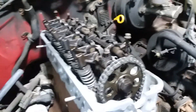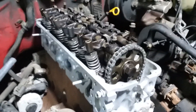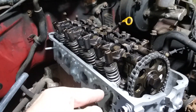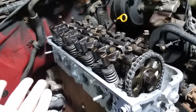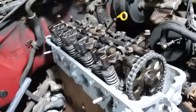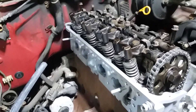This signifies the last of the actual internal mechanical parts that need to be addressed. Once I get this all torqued down, the valve cover can go back on and then it's just getting the intake manifold and the exhaust manifold back on. I did cut the cat off of this one — it was worth lucrative money, almost as much as I paid for the truck — so I sold it. Now I've got to come up with an exhaust system.